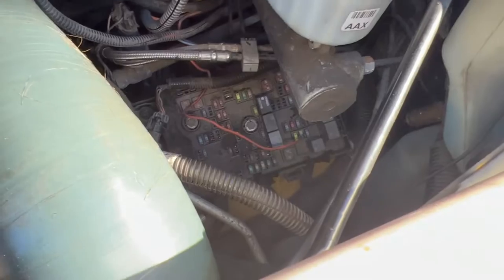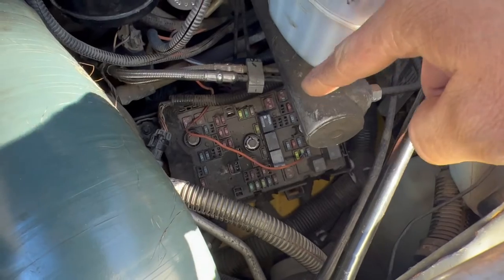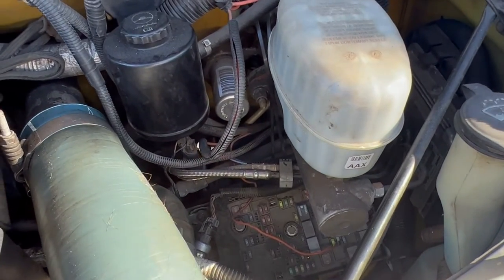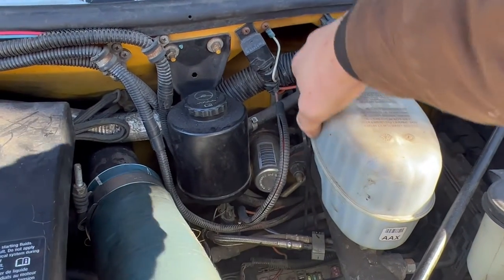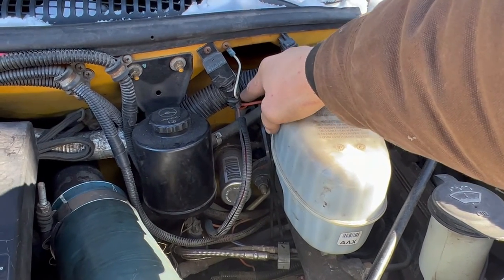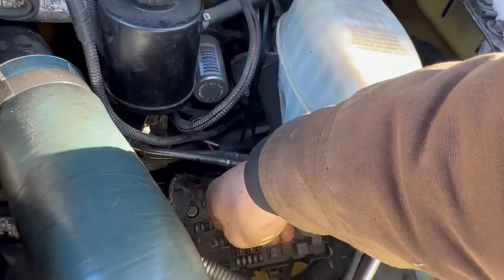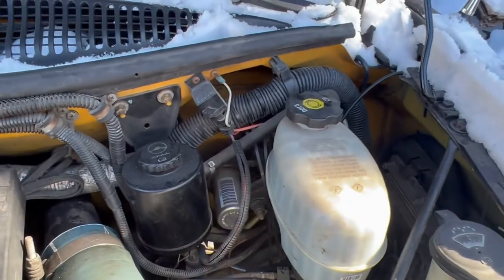the power wire itself. The only reason there are two separate wires is that it's creating a circuit. You have one wire that goes from the piggybacked fuse all the way through the bus to each of the emergency exit doors and hits the other side of the switch. The other side of the switch comes back around through this wire. Well, that's why there are two wires, a VDL lock 36 and 37, and it goes to the other terminal on the starter relay. Now, in theory, if you take this one wire that piggybacks from the fuse and splice it into the other wire that goes directly to this relay, you'll have power to the relay at all times.